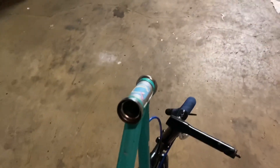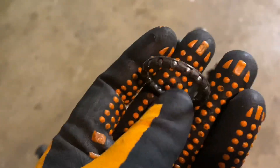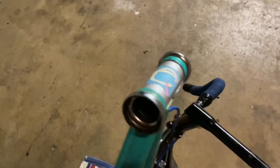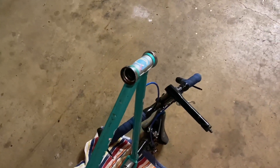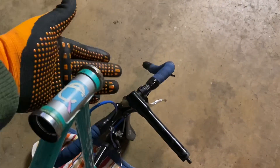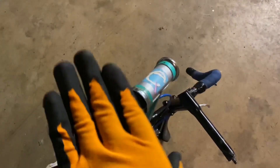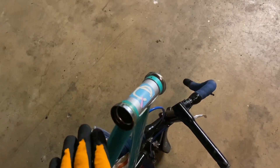You can see here - this is an 80s bike and I've never changed it. I've had this bike for 10 years, maybe less. But bone dry, bone dry, warped, rusted. This cup is like all bent the wrong way, so hopefully this solves the issue I was having - essentially the handlebars were coming forward and the wheel was going back when I braked, which was super annoying.